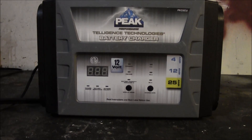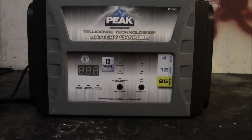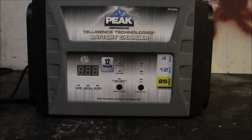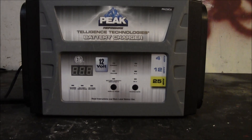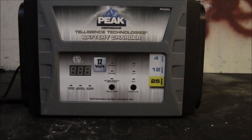What I really like is that it's fully automatic — a set-it-and-forget-it type of charger. The real-time amp draw gives you a great indication of battery state: if it's already down to two amps after a couple minutes, the battery wasn't significantly discharged and will charge quickly. However, if it's pulling 25 amps, clearly that battery definitely needed a charge.